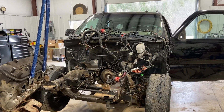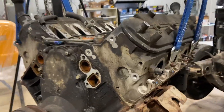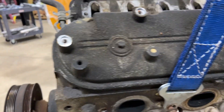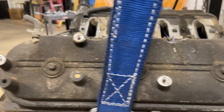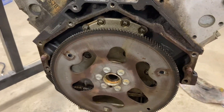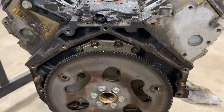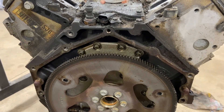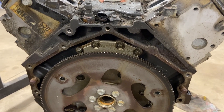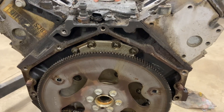We got the engine out of there. The wiring nightmare is still inside but we'll get that in a minute. We took the coil packs off — they're held on each valve cover with five 10 millimeter studs on each side. Back here are your six bell housing bolts; most of these are studs holding brackets and accessories on the back — fuel lines, wiring, vent lines for the transmission and transfer case. They have a 13 millimeter nut, and then the stud itself is a 15 millimeter wrench.